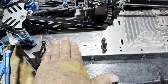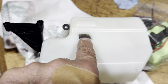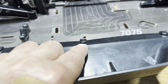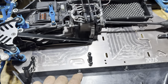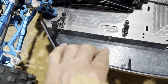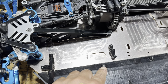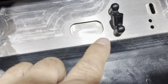First off, it was so dirty I took the gas tank off. When I did, I found a little hole almost through, and it came from this bolt right here sticking up. So if you have one of these SLTs, take this bolt off underneath the gas tank — it's the second one back. Just take it off and snip it off about 3 sixteenths, maybe even a quarter. File it down and screw it back in there. I snipped mine off, put it in, and then took a file and filed it off.